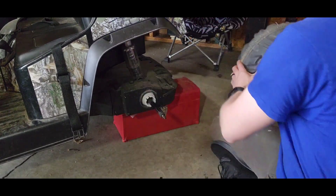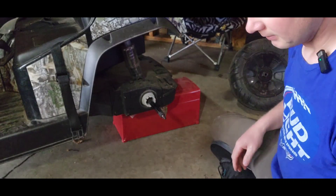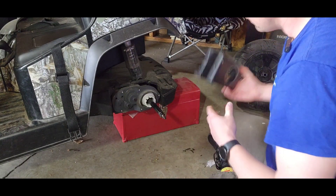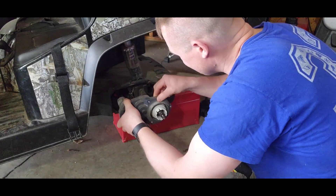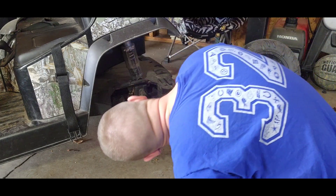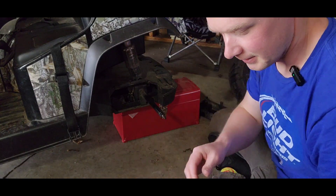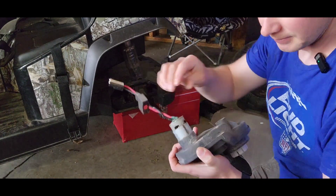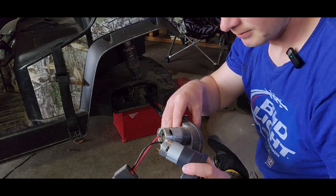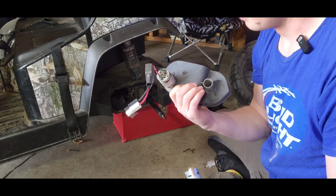Okay, we're gonna take this off — there are a few screws here, we get those off and then that housing will come off. That is off — there are six screws: three on top, three on the bottom. That comes off, we got our gear case here. Now it should come out just enough for you to pop this off — it's got some wires there. Well, that came unplugged — that's fine, I'll have to plug that back in. I've gotta take these off anyway because I'm gonna put the new ones in and make it so I can just quickly attach the new things to it. We're gonna take the other one off and I'll see you guys back in the shop.